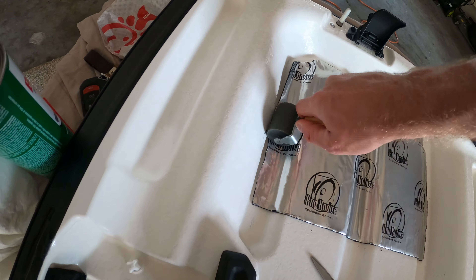I actually made a mistake — I cut this out and formed it to this shape but did it upside down, so now it doesn't work. What we're going to have to do is come in with these little scraps and just patch it up. It's not going to affect anything having little gaps here — we don't want to waste this material, it's not super cheap. It's worth noting that this stuff is number one super sticky, number two you're going to have to clean some stuff up, and number three this surface isn't necessarily going to be clean, so the same process we did to clean the underside applies here too. A little bit of brake parts cleaner and a nice wipe.